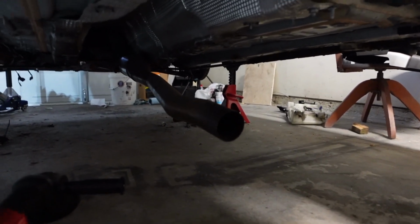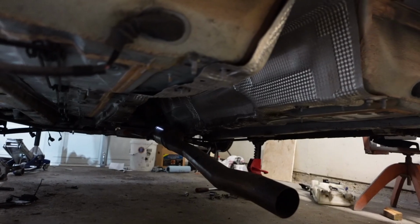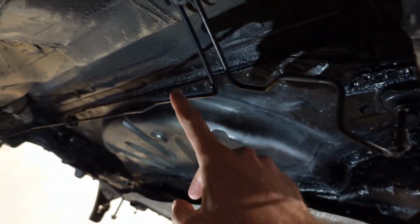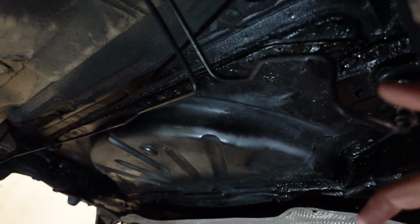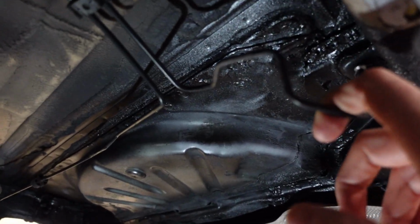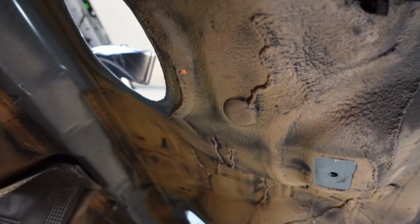And then if you look over there, the engine compartment is entirely assembled. And I have also ran the brake lines. These are from the S3 sedan. And the reason I ran these is because these brake lines are actually different on the all-wheel drive cars than they are on the front-wheel drive cars. So when I get the subframe in, these are going to plug in to place in these spots, and it's going to be fully factory. But right now, before we put the subframe in, we have to put the fuel tank in.